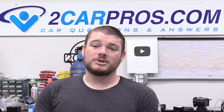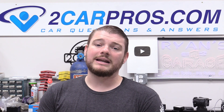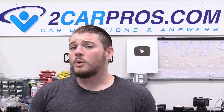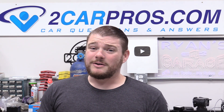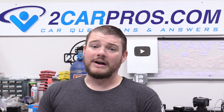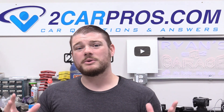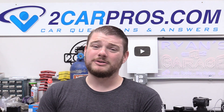Just call the dealer and ask them for a battery. I would definitely recommend getting one from Toyota OEM. When they're rebuilt from Toyota, all the cells have been replaced and it has been certified by Toyota for a Toyota. I can't guarantee that aftermarket battery manufacturers aren't just replacing one cell — so one cell is new and the others are old, they're going to charge and decay differently and they're never going to be in sync, and it'll just go out.